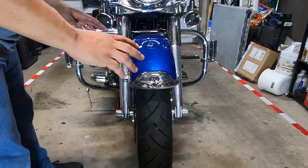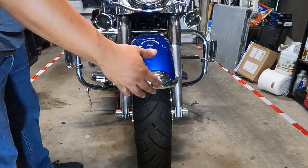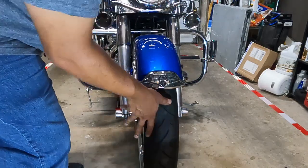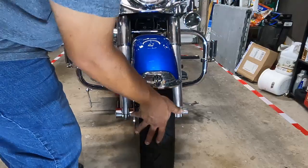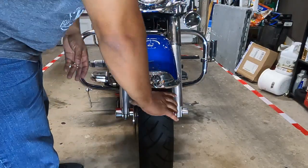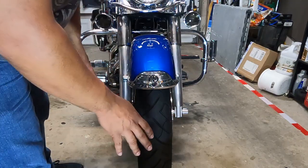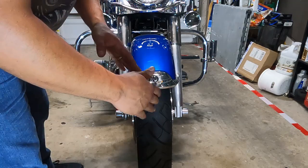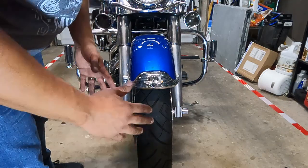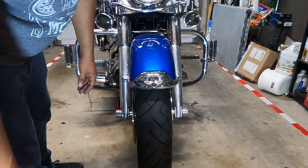We're all back together, guys. What you want to do is pump your brakes a couple of times if you had the caliper off — pump them a couple of times to make sure everything's set. Then check the wheel motion, make sure it spins freely. If there's a slight bit of drag, that's fine, but you shouldn't have to really crank down on it. If you do, something's wrong — take it apart and relook at it. If things look really, really off, stop what you're doing. You may have to reassess the whole situation and perhaps take it to your local shop.